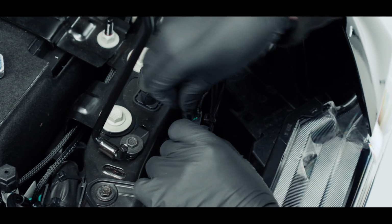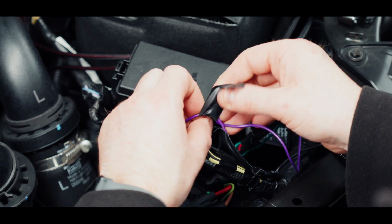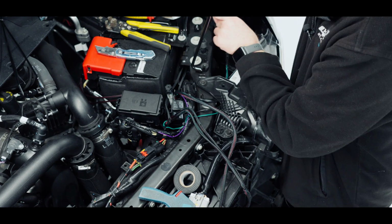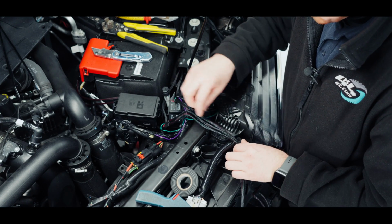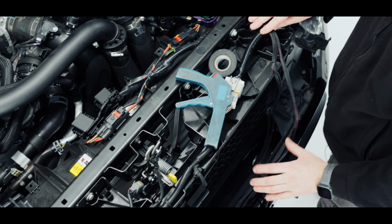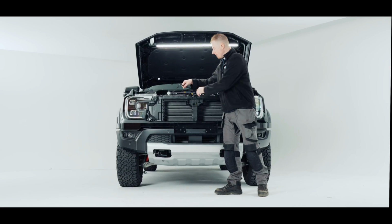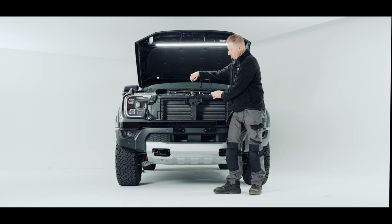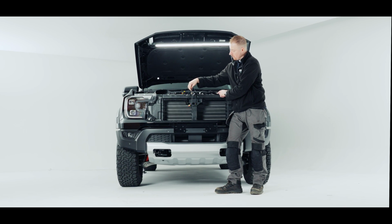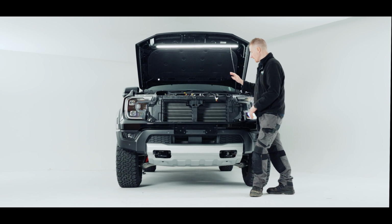So just going to put some tape around our joints. Now that we have both of them taped, I'm just going to cut this tie wrap just to hold that there. And then I'm going to bring both wires over here and then bring that down to here, onto there. So that wraps up our wiring. We have our 2 double looms here, which you could either put one to this light over here and one to here, and then your single to the middle, and just follow the factory wiring at the top. But all 3 are there, we're all wired in up here.